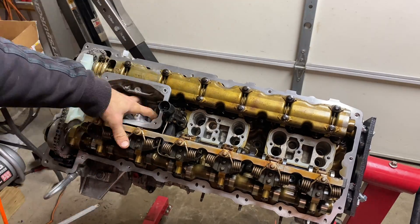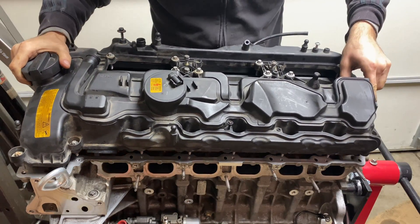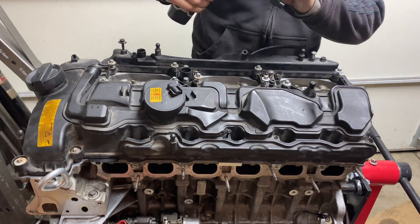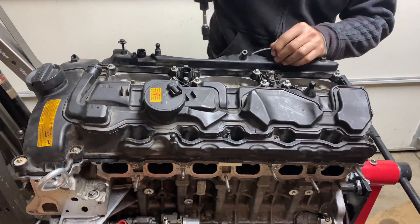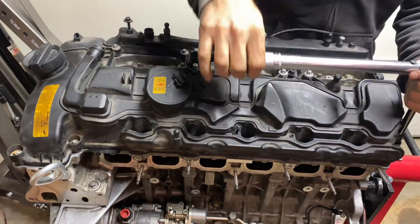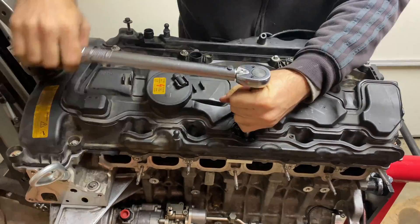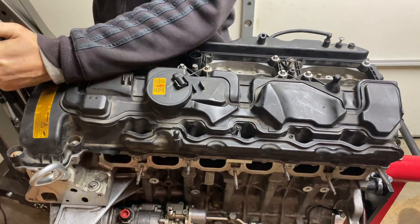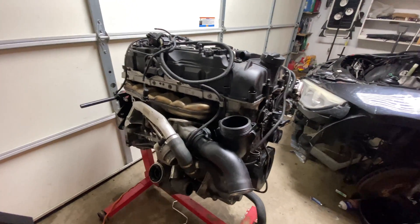In my case, I had to install the spark plug housing which came off during the rebuild. With everything ready to go, the cover can simply be lowered, making sure everything is aligned and torqued to spec. Torquing these bolts to spec and in the correct order is probably the most important step, as this plastic cover can easily warp or even crack if not done correctly. Refer to the diagram for the correct sequence, then hand-tight or use a power drill on the lowest setting on all the screws. For round two, each one gets 8.5 Nm in the same order. Do not go back on the first one to check or re-torque — they have to be done in that order and then left alone. If all went well, simply reassemble and enjoy your new valve cover gasket.